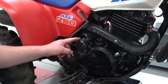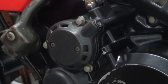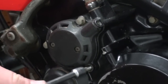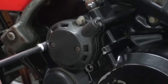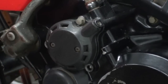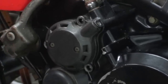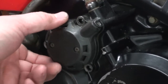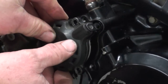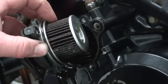The oil filter cover is located on the right-hand side of the engine. We're going to zoom in here and get a little closer look at it. It just has three six-millimeter screws with eight-millimeter heads on them. You just take those three screws out, then remove this cover. Just give it a little peck and pop that right off. Be sure to have your drain pan handy, because a little oil is going to come out of there with it.